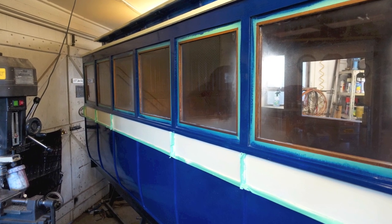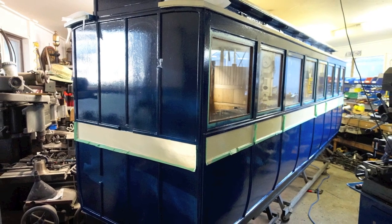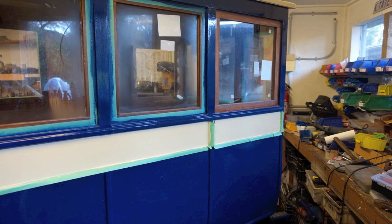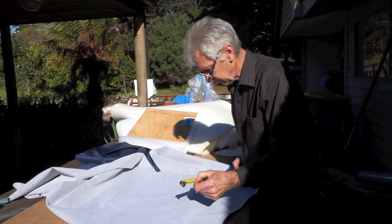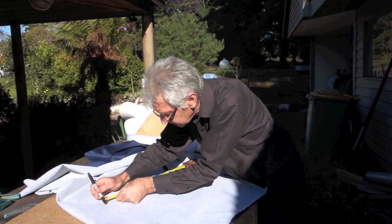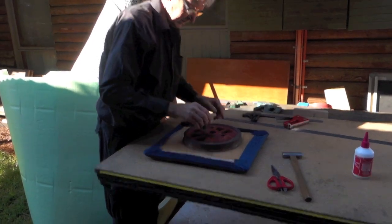When the body of the coach was finished, the whole body was lifted off the chassis and an 8mm rubber membrane was attached to the chassis for the body to sit on. The seats were formed on 6mm ply which was covered in foam, then Dacron, and then had a covering of velvet over the top.